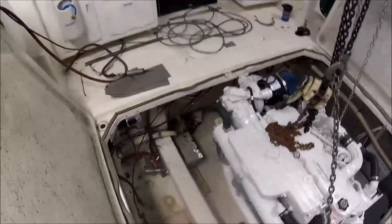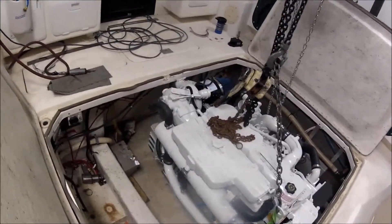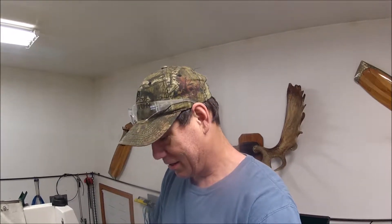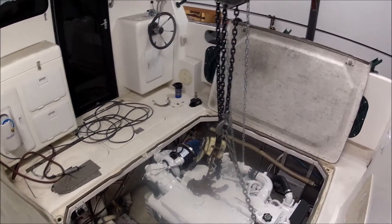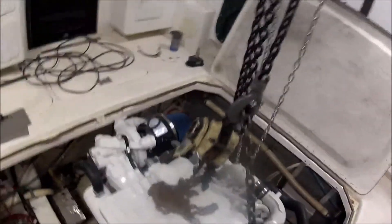Grinding some clearances in the motor mounts there. When I get going, I'll shoot a few clips and try to keep you up to date on the big progress of the thing, but it's going real well. The shaft alignment worked out really nice — I just hung the engine in position with the hoist there, and then I built the motor mounts in place to where the shaft lines up with the front of the transmission.